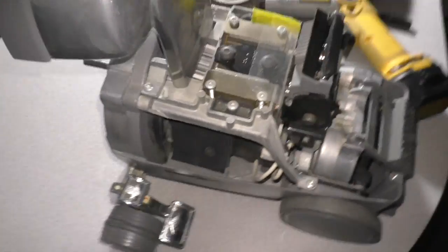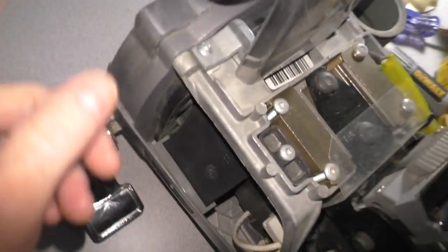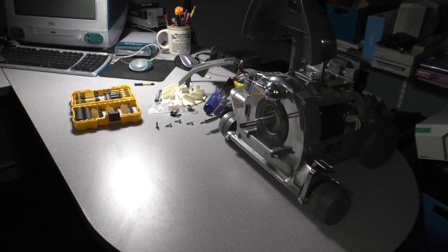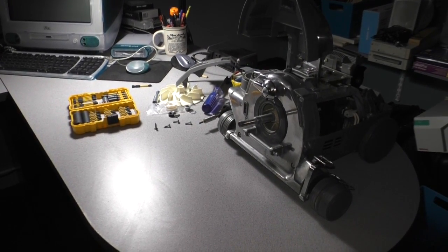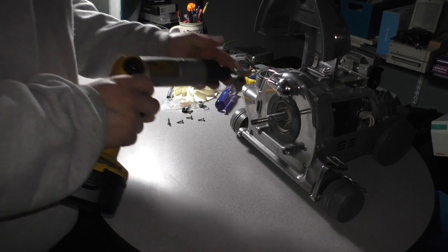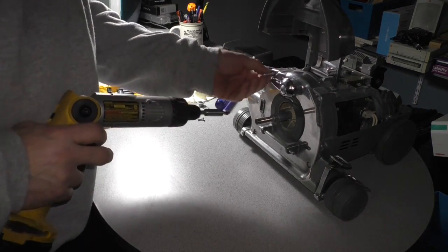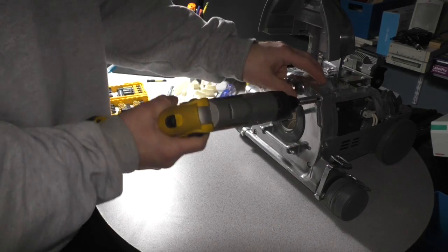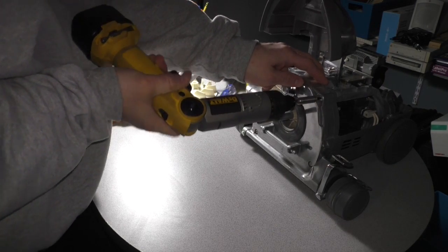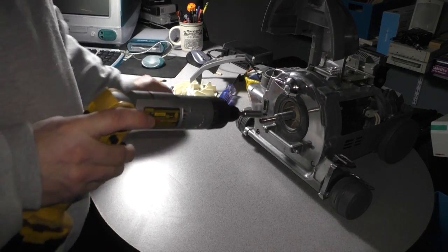So at this point, we need to remove the front cover off the power unit, which is held in by a couple of T20 screws. There's going to be some sealer inside there that we need to contend with. And we're just going to reseal it with standard automotive grade RTV sealant. I have never actually done this before. Oops. Never done this on a Kirby.